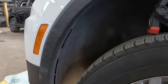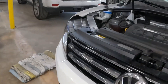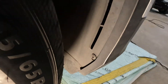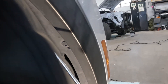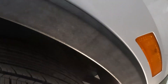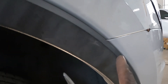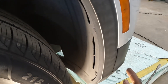We'll be doing the same thing for the opposite side. Let's go take a look. And over here on the last one — see, one, two, three, and this one down here in the bottom — four. Take the first piece from there, then grab the flare and pop it off partially. There's a screw behind this flare. That's it for the side. Now let's take a look at the bottom section.